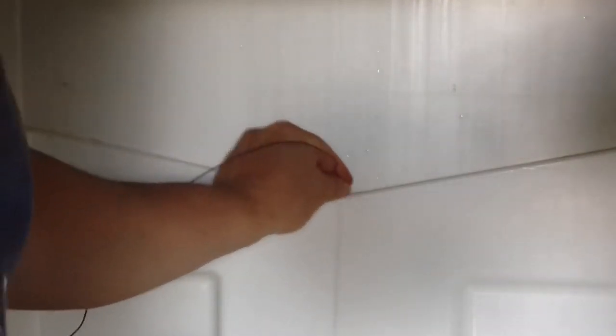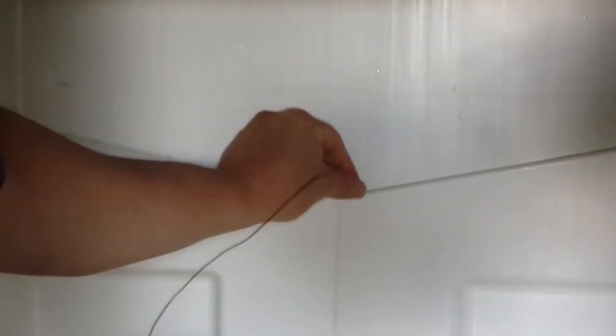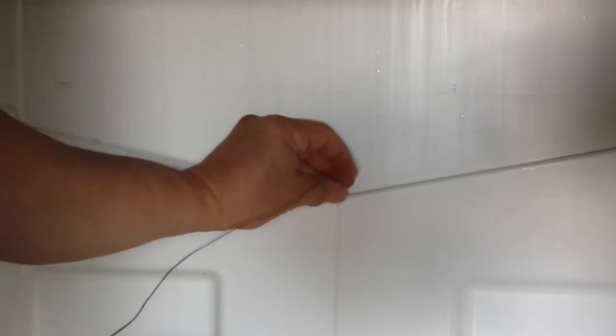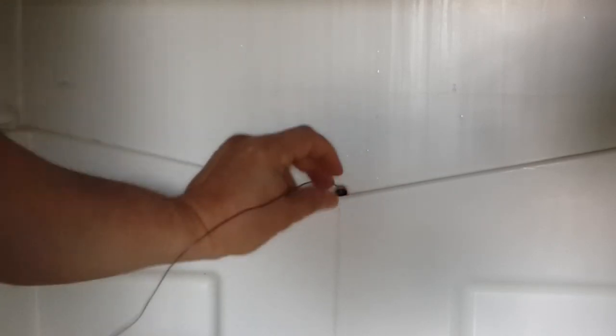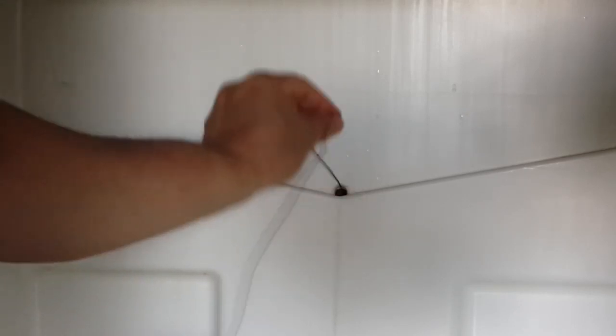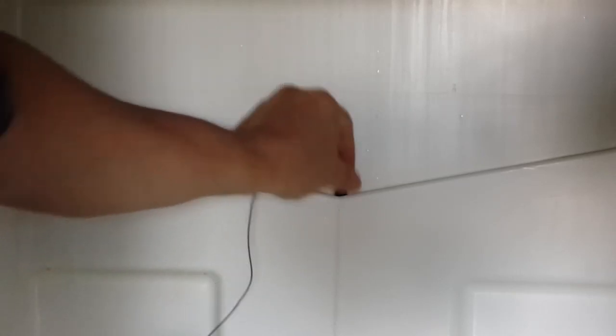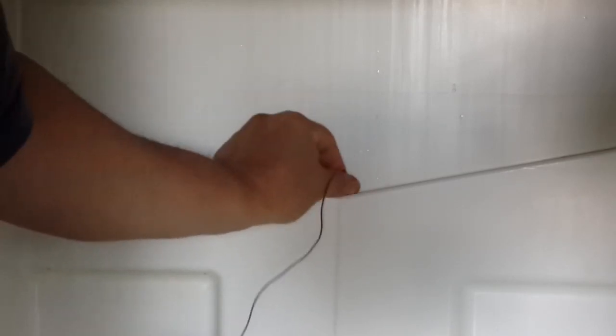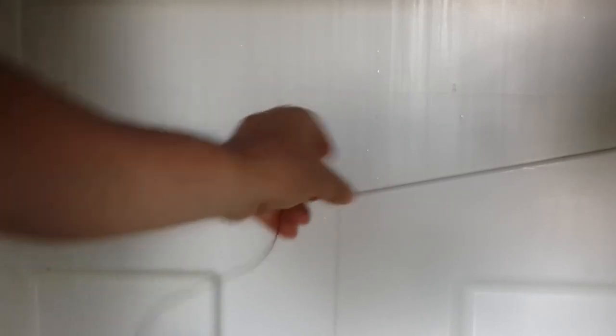Once again, I'm introducing the wire in the hole. Remember guys, you have to check a little bit the wire. Let the wire touch the walls. We have a bacteria accumulation, and that's the reason for the blocking. We don't want to mistreat anything on the way, just to clean the pad. For my refrigerator, as I said, it took like 85 centimeters. When I feel it is bending enough, I'm probably close to removing the wire. As far as it goes deep, try to introduce it. Once it doesn't go anymore, it's time to pull it out.